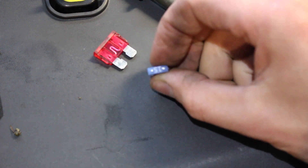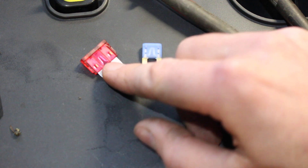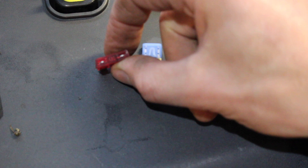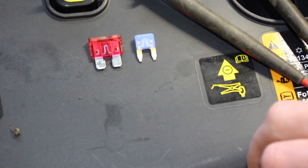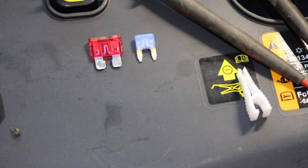Most of them have moved to the smaller format, but in both fuses you can see that the metal terminals on the bottom follow through to the top — two metal tabs poking out just a little bit. So instead of visually checking all these, taking them out with those little awkward tools or using pliers, we can run the multimeter through them all very quickly to check for continuity.